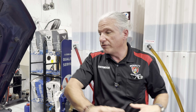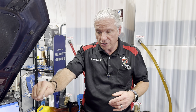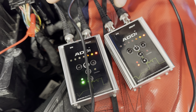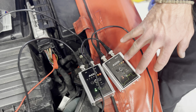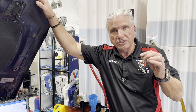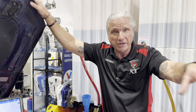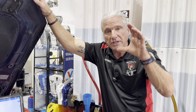That's the setup you'll use when you've got a misfire on a broken car — those two connections give you the data you need to make a decision. In this case, because we saw an anomaly, we hooked up a second unit to the crank sensor at the engine control module to get a crank sensor signal. We're looking at crank speed, not just the raw crank sensor signal.